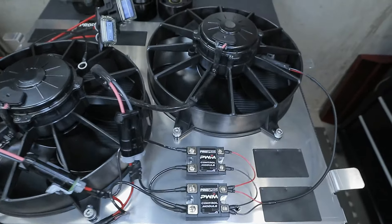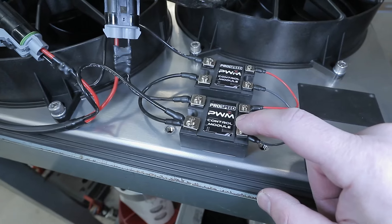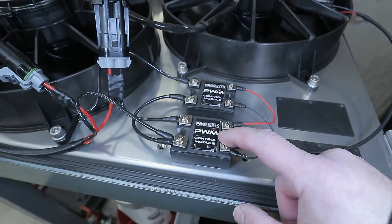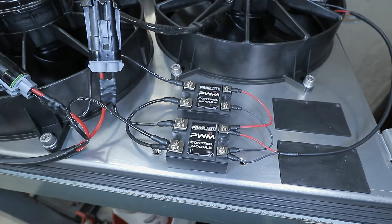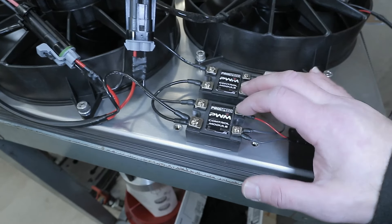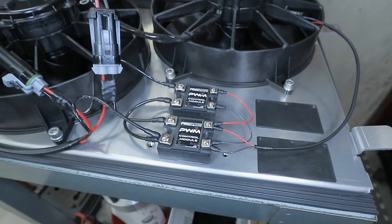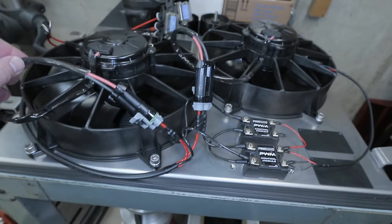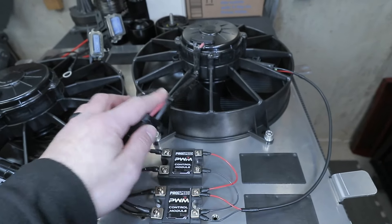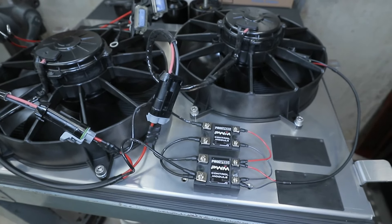This is set up for serious performance — a ProSpeed custom-made setup. It takes about four to six weeks once you place an order to get this fan kit. It's very specific to the ZR1; they make a separate one for the C6 and all the other models. It's a very simple layout: you drop your OEM fan out, put this one in place, run the positive leads to your fuse box, ground it, and connect this OEM connector to get the signal from your ECU.